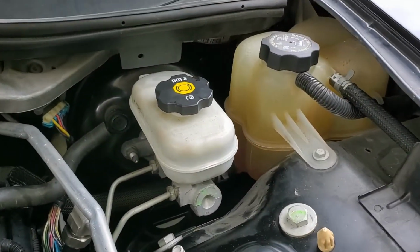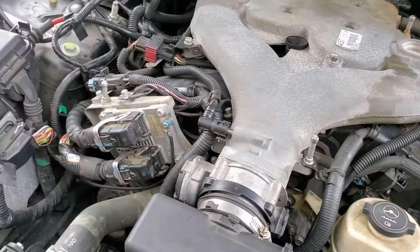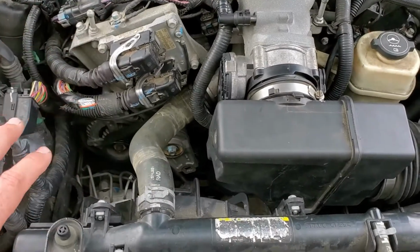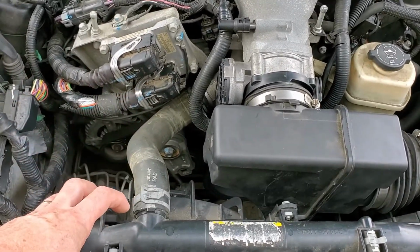There is only one way to put coolant in this engine. One of the things that I did is I did a little tricky thing. I left my top rad hose off. It was the last thing I put on, just about. And so I actually put a funnel and a hose in here, and I filled up the radiator because I wanted the radiator to be full.